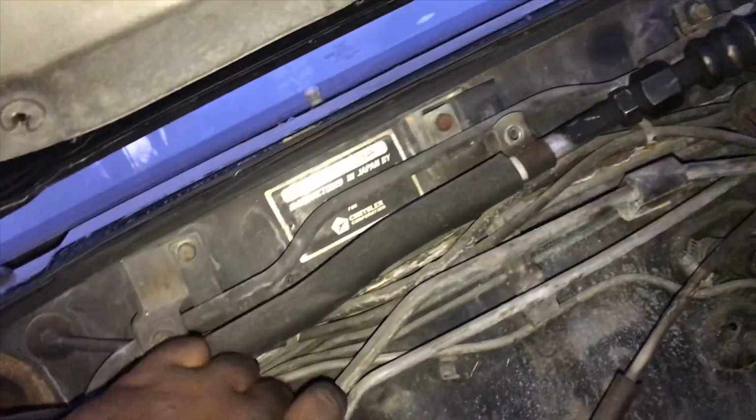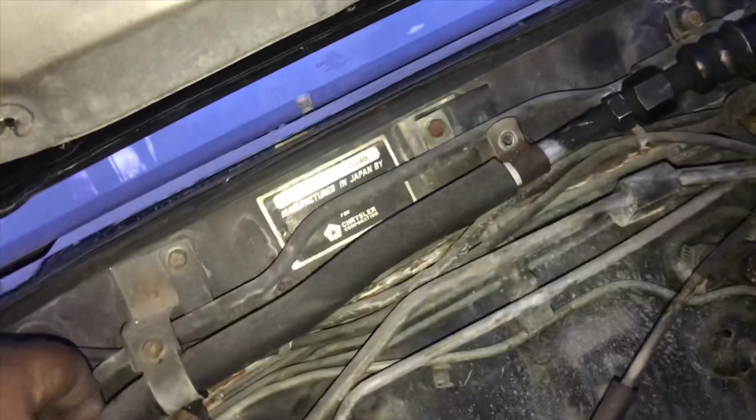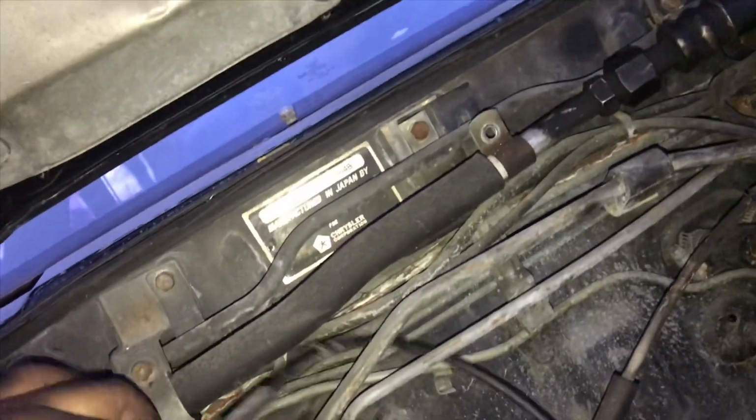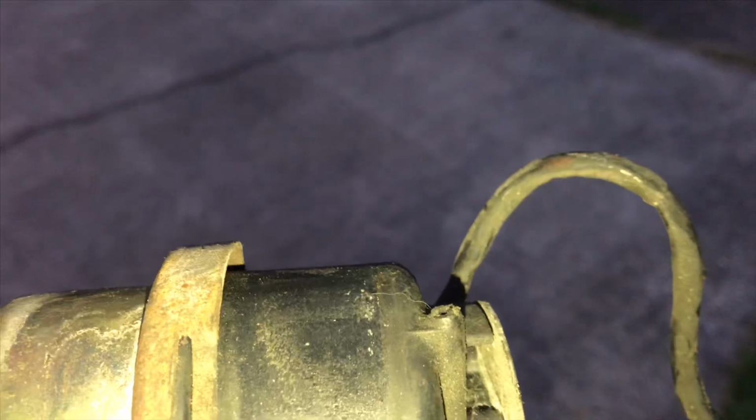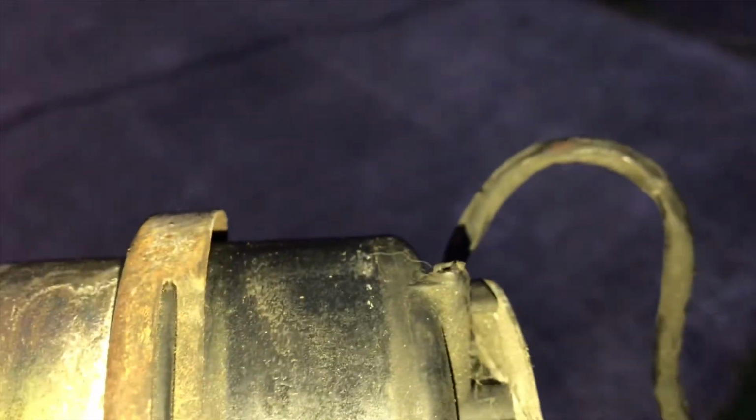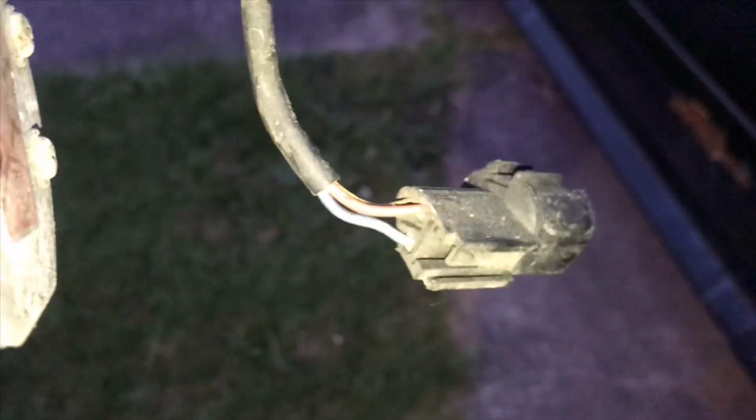Cruise control out. So if you are trying to keep your cruise control, fix it, diagnose the issue, you can reverse pretty much what I did, and you'll see here, this most likely is your problem. It doesn't have the vacuum piece connected, and it probably doesn't work. But if it is connected, you can chase down the wiring issue or cable issue and get this working.